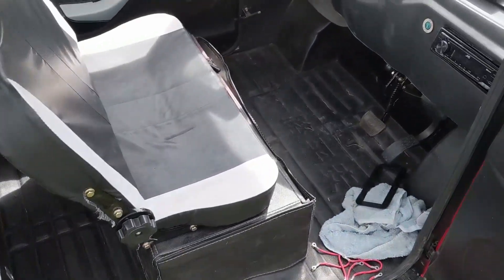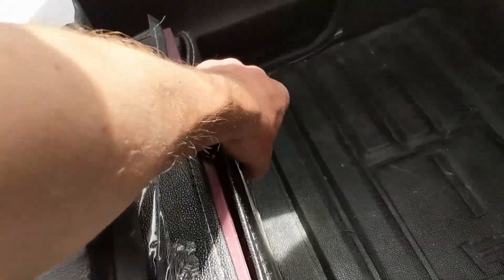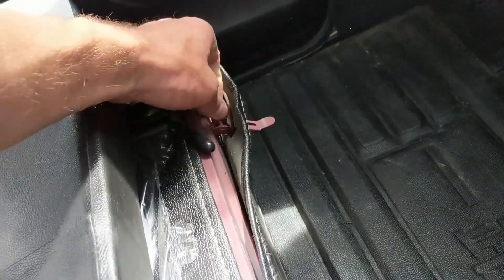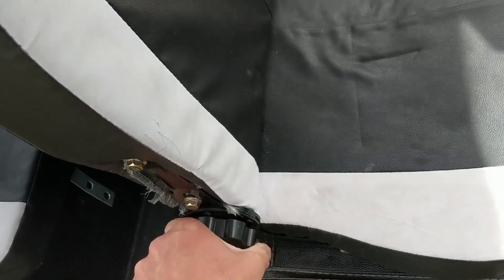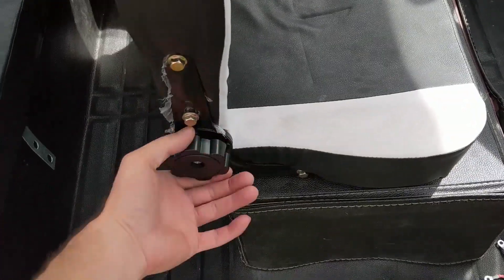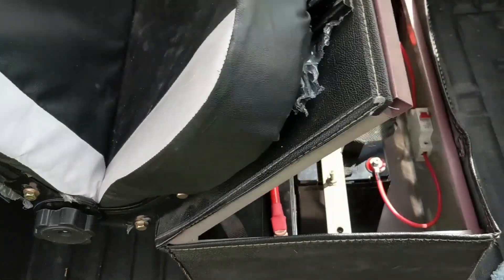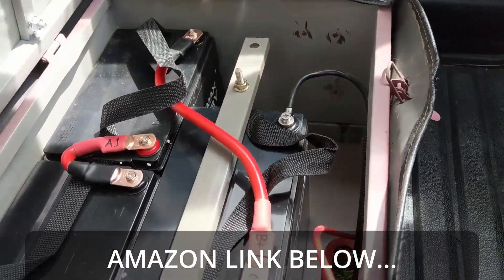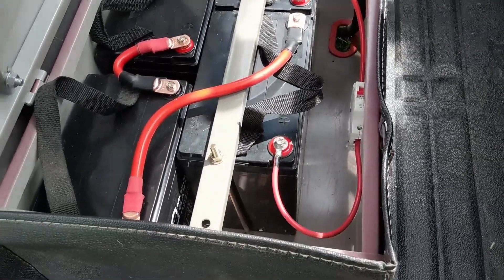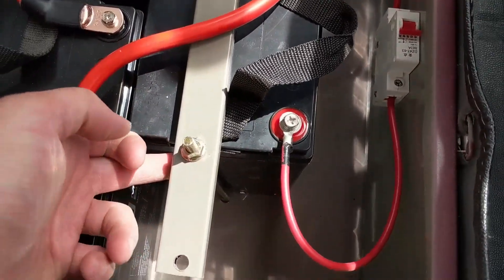I'm going to show you how I fit some bigger batteries in here. The batteries are under the seat — these little latch things are pretty ghetto actually. You kind of have to adjust the seat to get it to tilt back enough. These are 55 amp hour 12 volt SLA batteries, and what I did was just drilled a new hole for the battery hold-down bar.